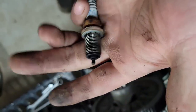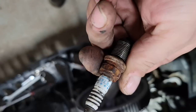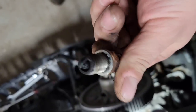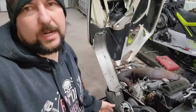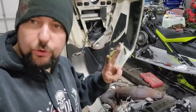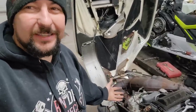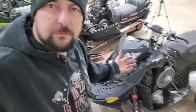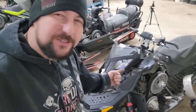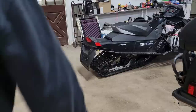I'd say that sucker's due for changing. NGK PFR 7AB — let's call up the Napa man and see if they've got two of these. And that's got to be the main reason why I love the older sleds. Literally two seconds, lift the hood, and there's everything you've got to work on right there. But all these new rider-forward designed snowmobiles — the engineers treat these engines just like the mafia treats eyewitnesses. They bury them deep down in there.